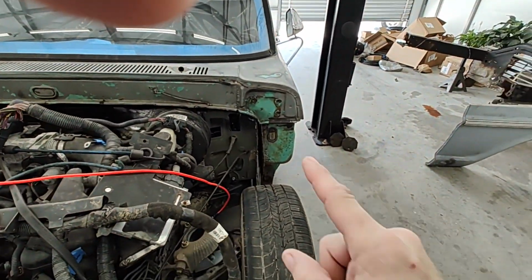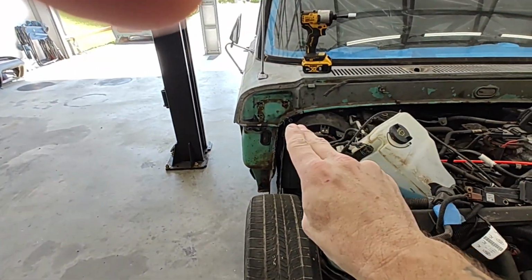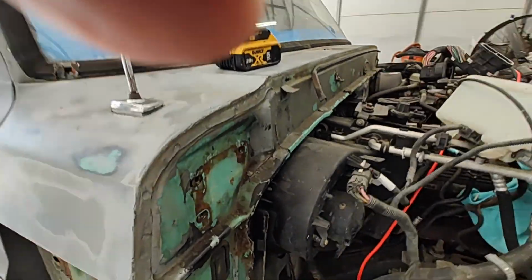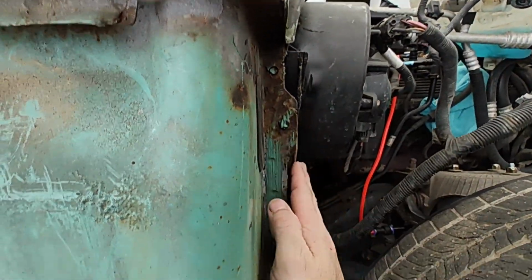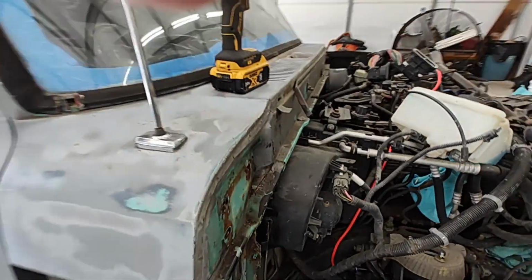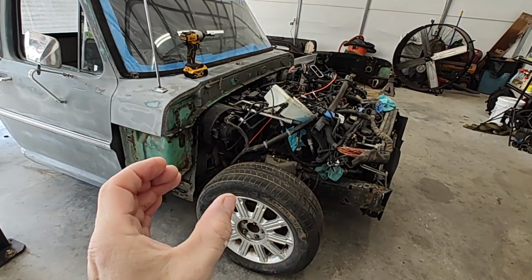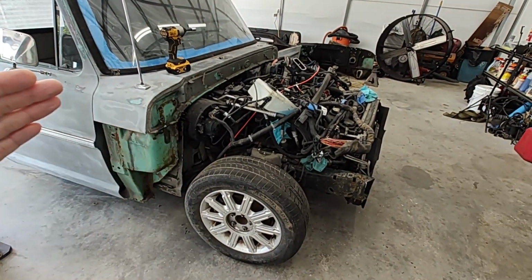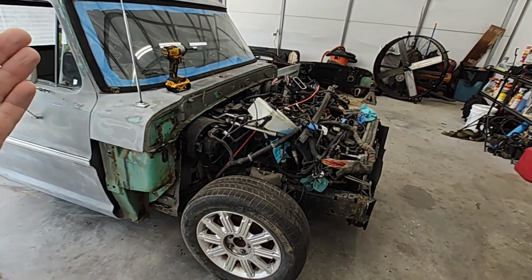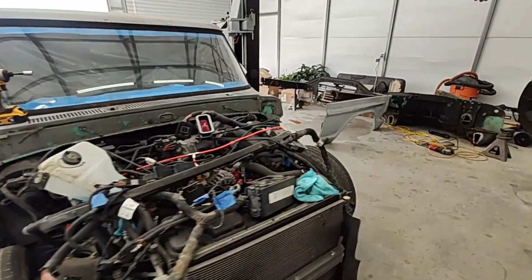You want to make sure you got the same gap in there, a couple fingers fit in there. But you can see again over here, we're lined up with this metal from the firewall to the Crown Vic. So that's about as far as you can come forward, and your wheel starts getting set back in that fender well. Can't go back too much further because you start hitting your firewall to the car. So kind of stuck where you are.